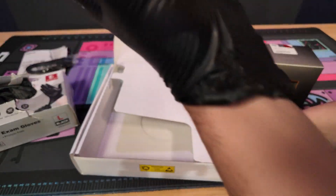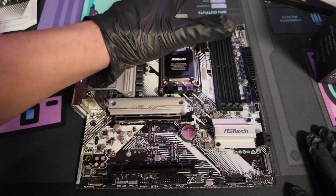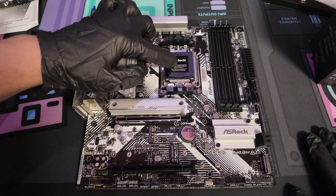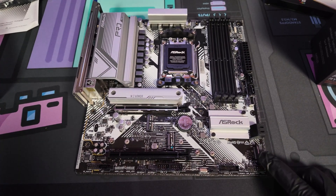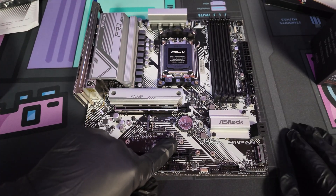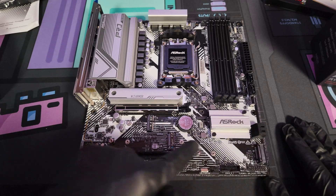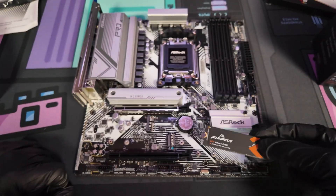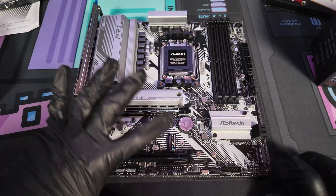Carefully take out the motherboard. A few things to go over: we have the RAM slots here — sometimes there'll be two, sometimes four; on a nicer motherboard like this there's usually four. We have the CPU slot, and different options for the M.2 — one right here, and then a faster higher-quality one. The website for the motherboard will show what each of these slots can support, so make sure the storage device you have is supported in the slot you put it in. We need to know where to put the CPU, the RAM, and the storage.